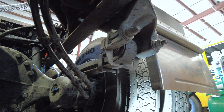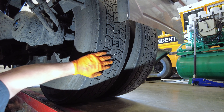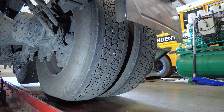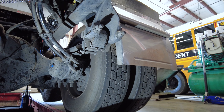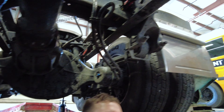Anyway, there was no abnormal tire wear or anything. Most of the time we'll feel around the tire, we'll look for cupping, we'll look for wear on the inner side or outer side — that'll indicate an axle is tracking wild. But the customer's suspension was fine. He said he still had a pull because he had a lot of work done on the front.